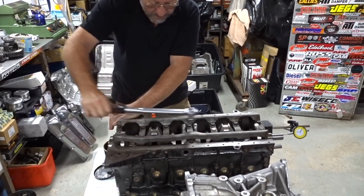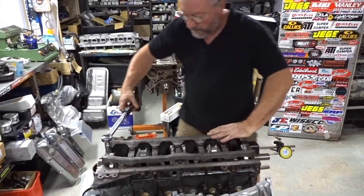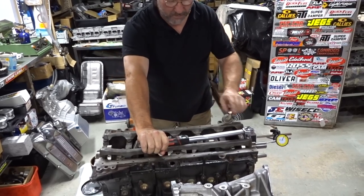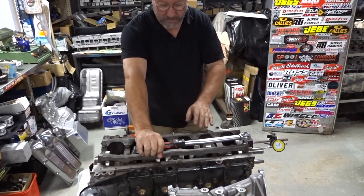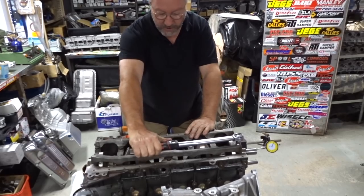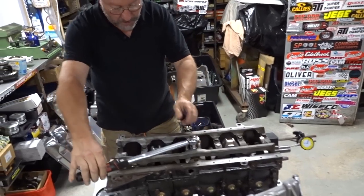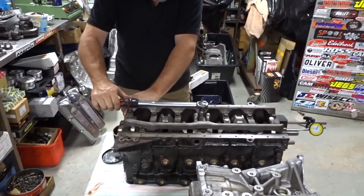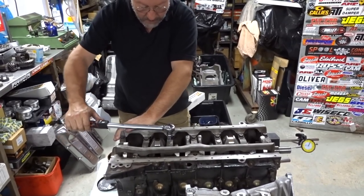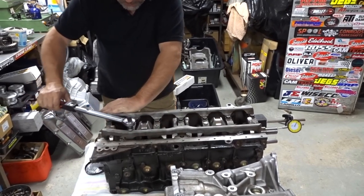Usually got these on an engine stand, but all the engine stands are full - got a bit of work on. So then just finally, once that's bolted down, check it again for good measure. I've got a good five to six there. So if we had three at this point, we'd tap it to seat it. We're happy with five to six - happy to put that in. Old Nissan got it right eh? They did a real good job of that. Whatever machine they used, I'd like to have a look at it - there's no automotive machine that can get it that accurate. My brother Moore does have a real nice machine that he's designed, where he can tunnel bore stuff within a tenth to two tenths accuracy - probably the only decent machining setup in Adelaide that you can get a tunnel machined really nice.